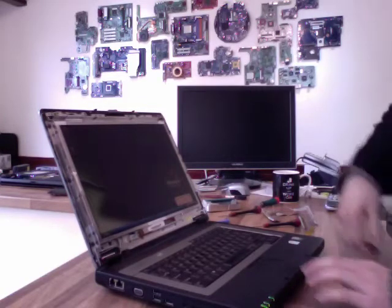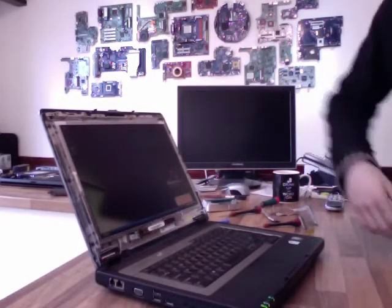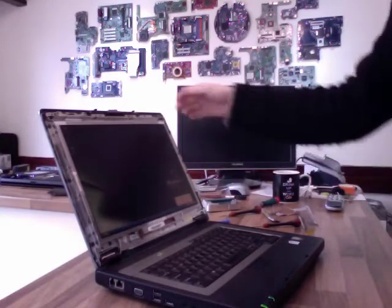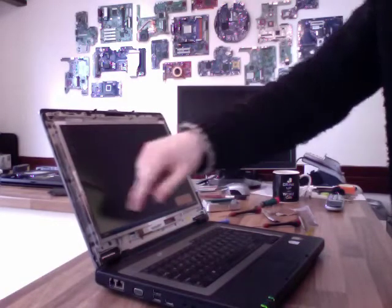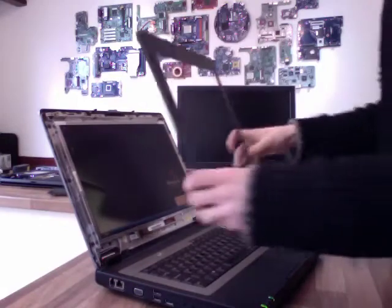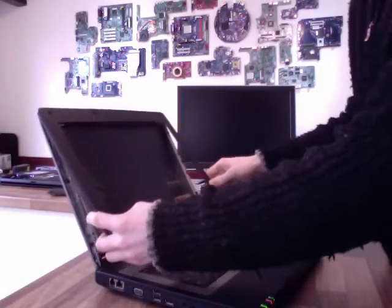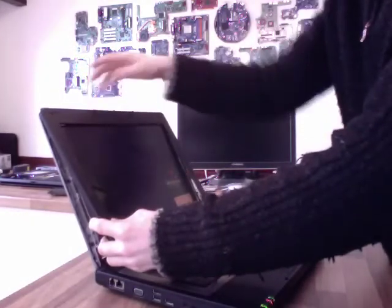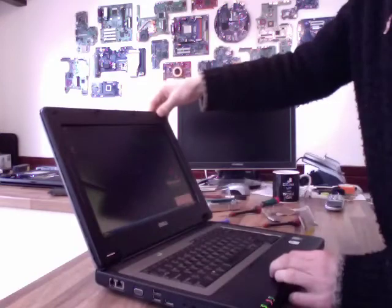So if it's a brand new panel, you might have some cellophane across the top or something like that. This is normally the point where I tear that off. You can see there's some masking tape on the side of this one where previously it has had that there, but just rip that off at this stage and then fit your bezel again. You've just got to hook this over any latching hooks you've got at the top here, line it up with the holes, and then just literally press it so it all clicks into place.